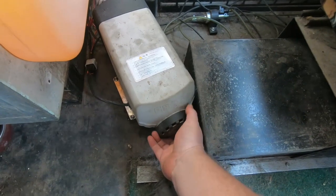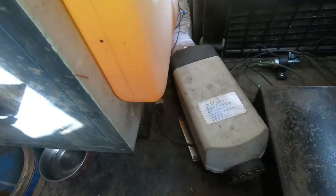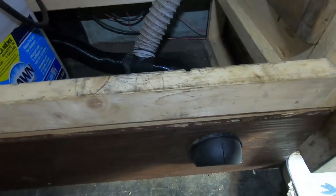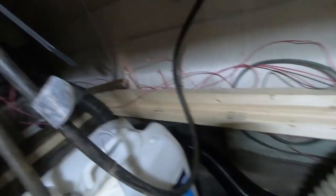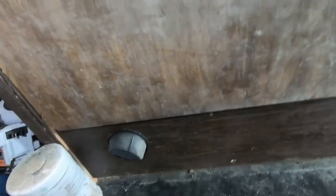Yeah, it just lives here, and so far seems to be a good place for it. Let me show you the ductwork. I've got these ducts in the front of the lower cabinet and they spin around — you can aim them in any direction you want. There's the pipe that was hooked to the heater, comes in, just a splitter, goes into this pipe. And then it runs back along behind my fridge, drops down through the panel under the fridge and comes along here to the outlet in the front. And this one kind of blows back to the bed area.